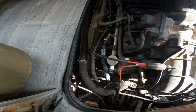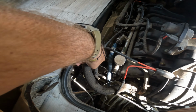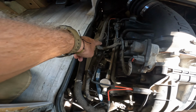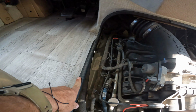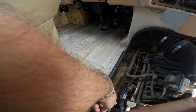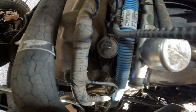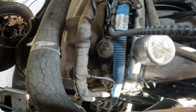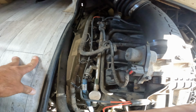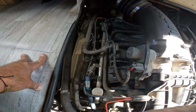All right, so I don't know if you can see just quickly, these are the coils right here. This is here, here, here. Driver's side looks like shouldn't have any issues getting any of them. Looks like I have plenty of space. And then there's the 7mm bolt that holds the coil down. So I'm gonna go right now, I'm gonna unzip all of those, take that out, leave the coils on, then we're gonna run the engine for 15 minutes.